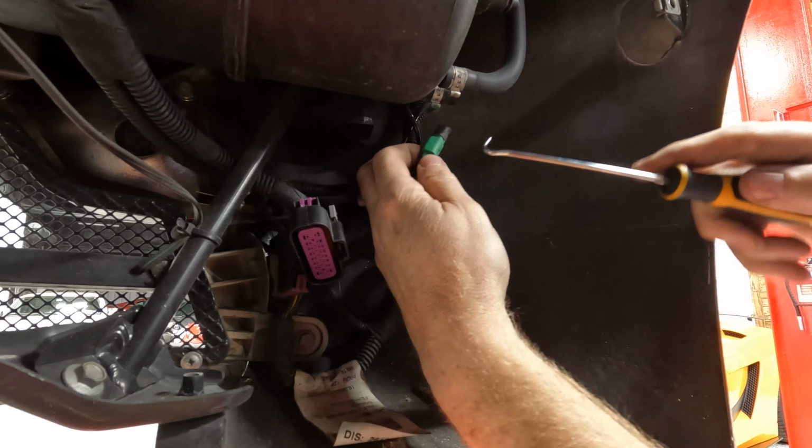All right, now that the exhaust is all the way in, we can tighten down these three and those two bolts on both sides. We're still gonna leave the clamps loose on the muffler section and the X-pipe until we get the bumper on, because I just wanna make sure everything is aligned correctly. It looks pretty darn close, but I don't know if I need to turn it or scooch it one way or the other, so we'll leave it loose until the bumper's on. We also have to put on those gold tips on the bumper, and that's super easy. It's just five or six screws, no big deal. Then we can put the bumper on, get the fender liners on, and put this thing back together.